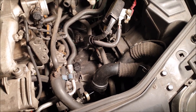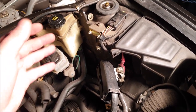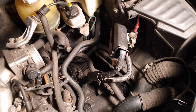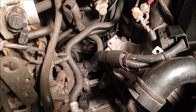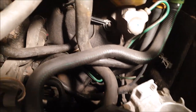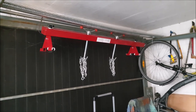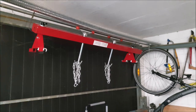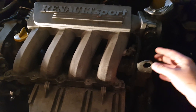For the steering, I didn't take it out completely — I just loosened the reservoir on that side to make it free, so when the downside of the car goes down these hoses don't get broken. You need to disconnect the steering column, which is a bit hidden — under a rubber gum the steering column connects with a joint, and you need to disconnect it there. Use an engine bridge to keep the engine inside the car, because if you remove the gearbox the engine will fall if it's not fixed.